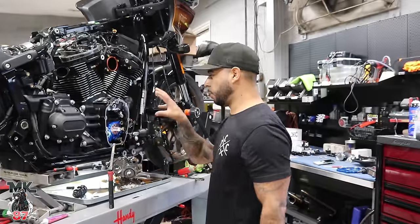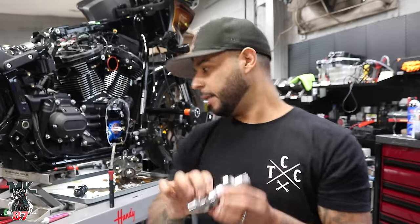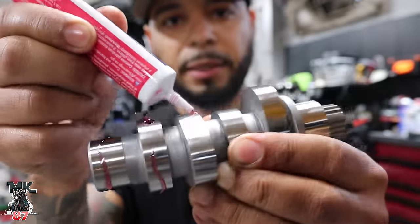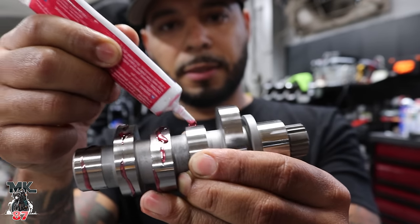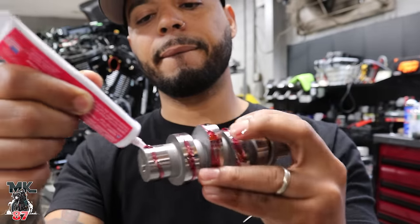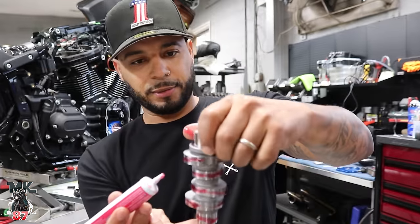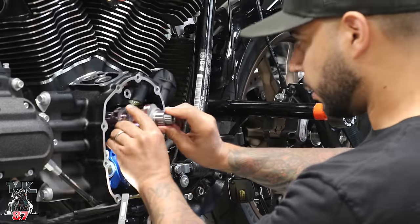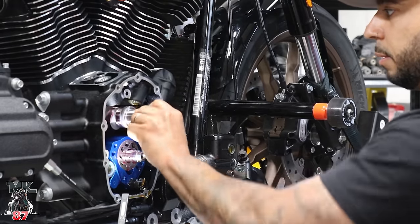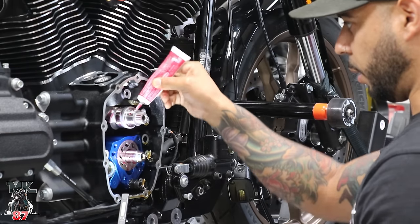All right, so oil pump is in. What we're doing now is popping in the 483 Cyclerama cam. So we're gonna be lubing this up. A lot of lube. I'm learning a lot of stuff today, man. It's pretty cool. All right, you can't spin it when it's all in. So now just lube the end lobe. When it's all the way in, you can't spin it. Oh, okay. It'll be pulled forward when we're done. So just lube the front part of it now then?